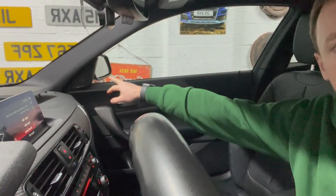I've done a bit of Googling and there seems to be a common modification — to disconnect the centre speaker that sits behind the iDrive screen in the centre of the dash. I'm going to try this: disconnect it and see if I can tell any difference. The majority of people online suggest that as soon as you disconnect it, you hear a world of difference and all of a sudden you can hear cleaner and more defined left and right channels. There are quite a few times where I've genuinely wondered if the driver's side specifically is not working or is broken because I just can't hear anything from it. This is what people suggest is the solution — disconnect the centre speaker because it just muddles the left and the right.